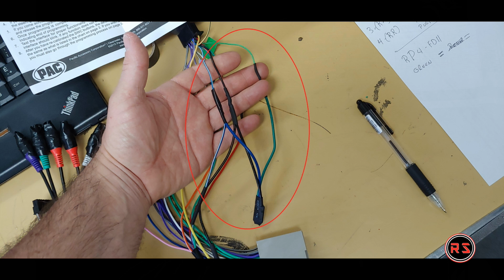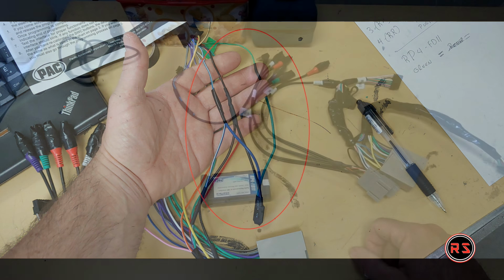And on the Pioneer, the green wire goes to the parking brake, so you can go into the settings of your radio without driving. But if you want to access your settings while you're driving, you can install a micro bypass, which is what you're watching in the image at the moment. Don't worry, I don't want to watch a movie while I'm driving. The reason I installed a micro bypass is because there are very basic settings in the radio that require applying the parking brake, which is nonsense to me.